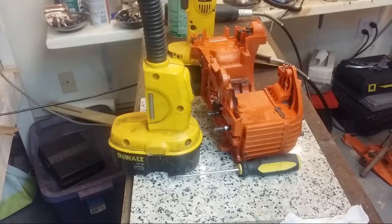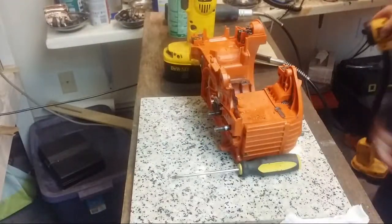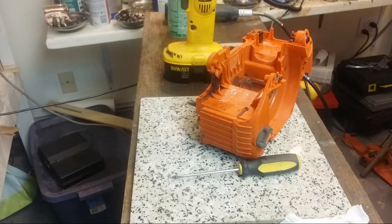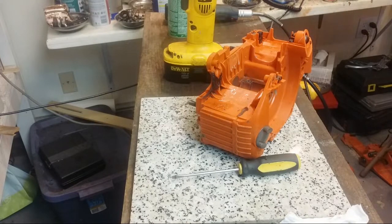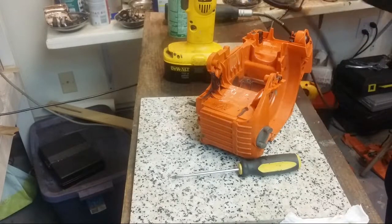The inserts are not pressed in. They are molded in somehow. They might be actually molded in when it's injection molded. It's possible. So the simplest thing to do is just knock them down. If they're a little bit on the low side, that's not going to be a problem, I don't think. Get a ball end carbide and hit them. Right, I can put the block on it too.